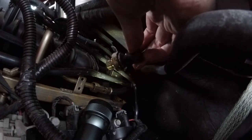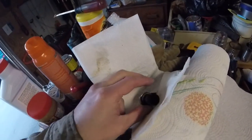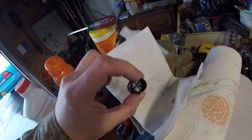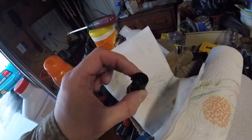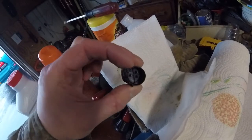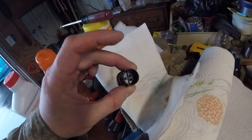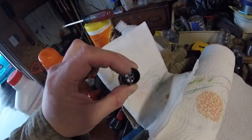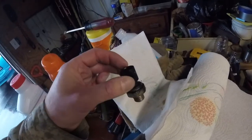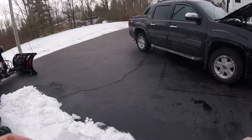There it is — and that's our culprit. Got a little bit of oil on it, so it might have been seeping. One important thing to remember when you pull this sensor out: make sure the rubber weather seal goes back into the new sensor. Because this truck is newer — only 34,000 miles — the rubber stayed on the clip when I pulled it out. If you're working on an older truck, that rubber may come out in the old sensor; if it does, take the o-ring out of the old sensor and place it into the new sensor before plugging the clip in.